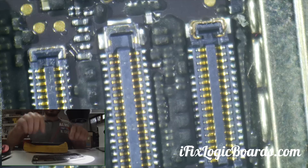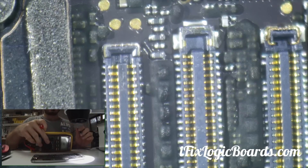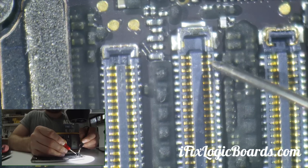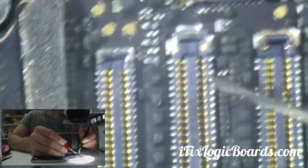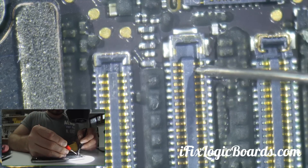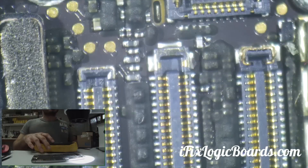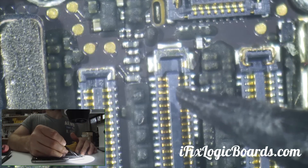Setting up the multimeter, I'm plugging in the battery. I'm going to have my meter like this, hopefully you can see it. One reads 3.7V — that's normal. And the other one is 2.81V. So there's definitely something going on on that second line here.